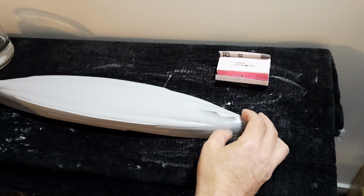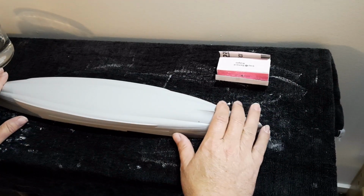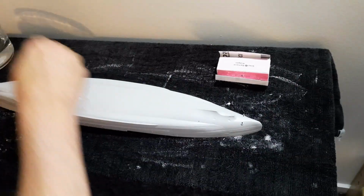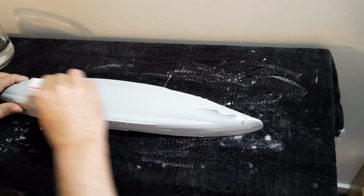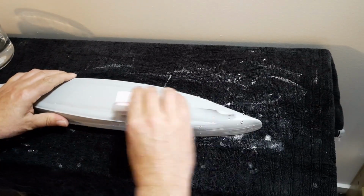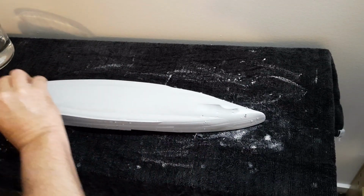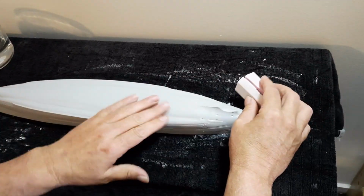Okay, now I've set up. We'll just continue on with some wet sanding of the undercoat. There were some blemishes, a bit of fluff that you've seen went into the paint. So I think what we'll do now is we'll just wet it down, and then we'll start to re-sand this and take any blemishes out of it. Spray painting can leave a little bit of a rough surface.